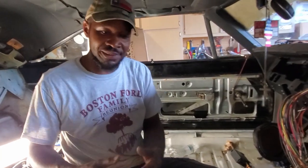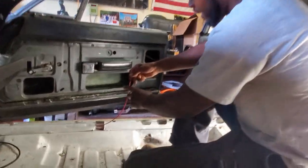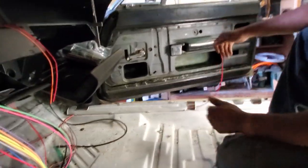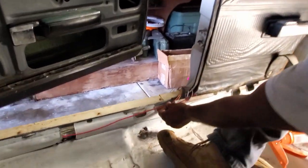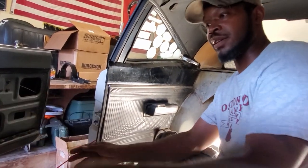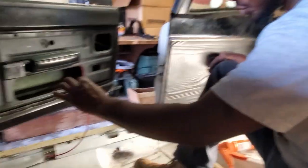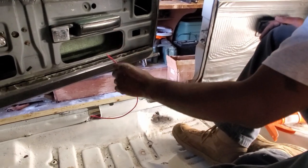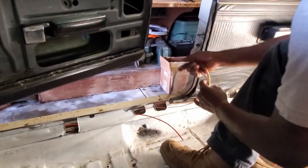At this point let's move to the trunk and split this out left and right. This wire we pulled out of the original harness - since we're trunk-mounting the battery, this is the one we're going to have to extend because normally batteries are mounted under the hood and this would have been plenty of wire for that. Since we're doing it differently with this swap, we'll extend this one and pull the rest down into the trunk. I'll leave this one short so we don't lose it in the harness.